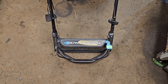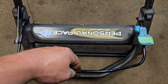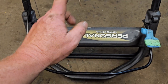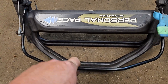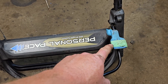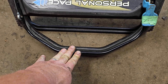Here's how it works. On a traditional mower, this bar here starts and stops the engine — when you clamp the bar it releases the brake and allows the coil spark generation to reach the spark plug so the motor starts. On these BBC mowers, this lever engages and disengages the blade from the engine through a clutch. I've taped the interlock out so I can actuate this with my foot while I'm filming the bottom of the machine to show you how it works.